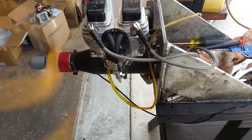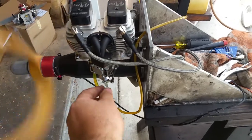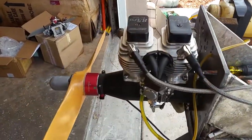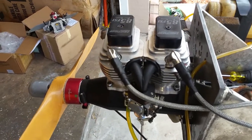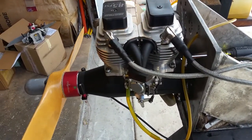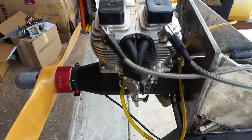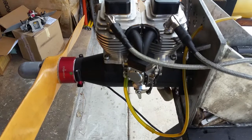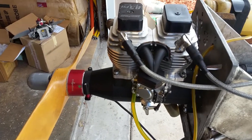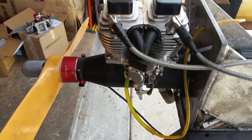One of the things I didn't like was this long spool-down — the time it takes to get down to low idle RPM. Once it gets to a high RPM and you stay there and come down, it takes a while to drop to really low idle. That's why I looked at different carburetors. I have one that works a bit better, but I think what it needs is just a little bit bigger diameter on the venturi, which will help with the spool-down.